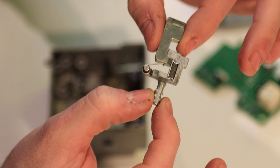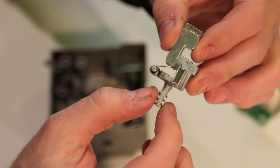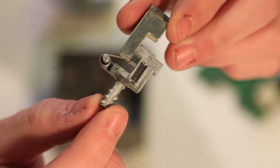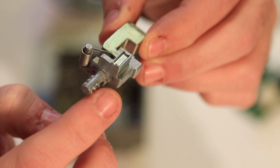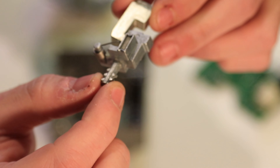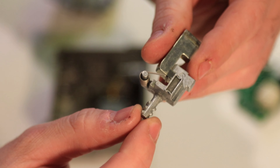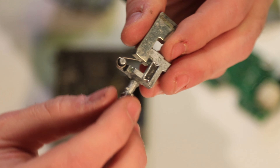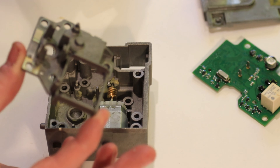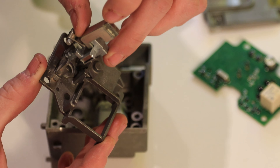Your fix is to remove this piece of metal from the black cog and then super glue it back onto this piece here — the super glued part is just here, that's where I've super glued this together. Now that it's one piece again it will allow the car to start again, until the super glue gives up and I'm back at square one, hence having to order a new part. When you've super glued this leg back on, leave it for at least half an hour — minimum — ideally overnight, because you do want the super glue to hold strong enough so the motor doesn't rip it straight off.